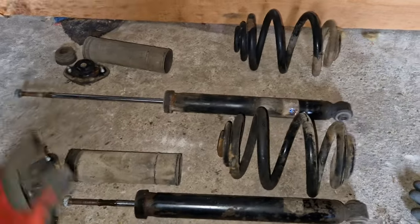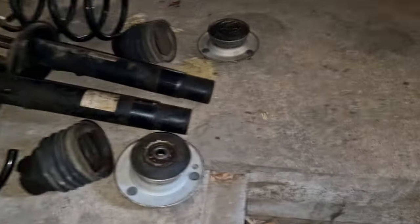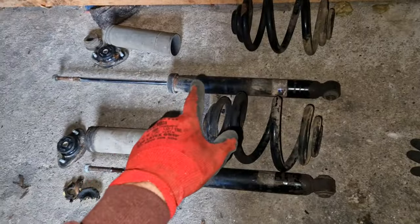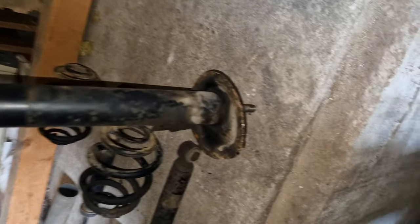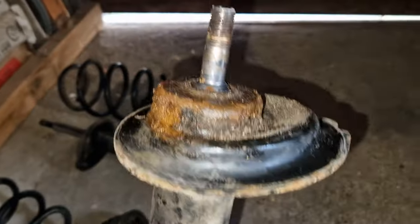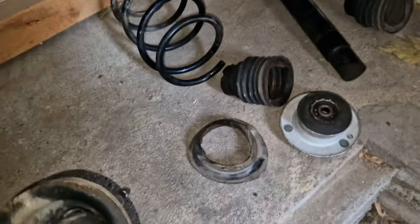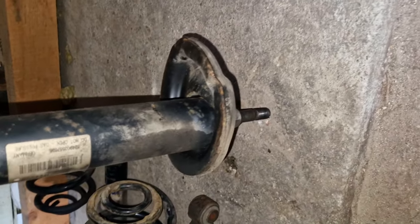After all was said and done, this is the rear, these are the fronts. We have a few interesting things. First off, both passenger side shocks are not dead, while driver side, very easy to compress. And there's obviously dirty rust underneath, dead. While the passenger side, although it has rust on the strut itself in two spots, has less rust on the shaft, and it takes much more effort to compress this,